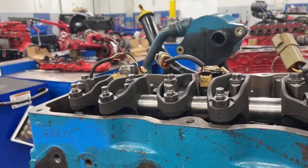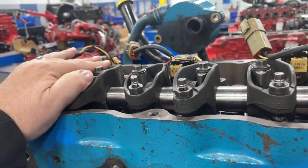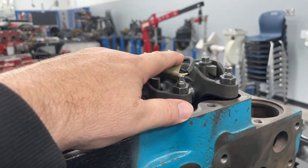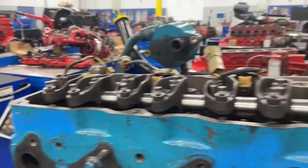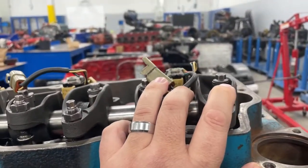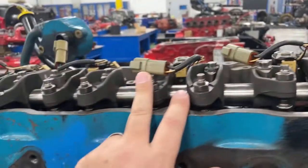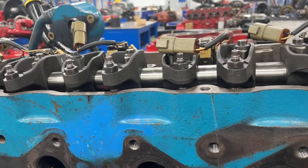If I can identify that cylinder number six is in valve overlap, that means it's at the top of its exhaust stroke, which means its travel companion cylinder number one is at top dead center of the compression stroke. Why is that important? Because any time you're doing a tune-up on one of these engines, it's going to have you look for overlap — usually on cylinder number six. When cylinder six is in overlap and one is on compression, a typical tune-up chart tells you to adjust both valve lashes, then intake, exhaust, intake, exhaust, and neither.